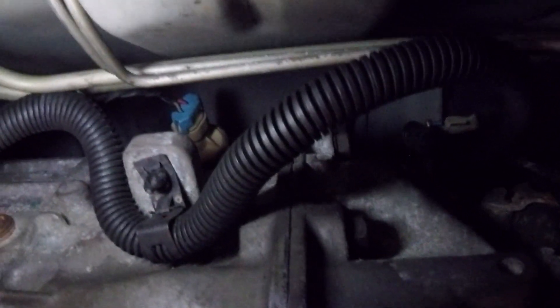I'm going to try to reach up in there and see if I can do it. Alright, so I have that white connector out — unfortunately the blue thing kind of popped off on me. What I did is I reached up there with my hand from this angle and was able to pop it out. So we're just going to plug that piece into the new resistor and then plug that part in. We got the skip shift eliminator installed up in there — you see that — got the little harness on there.